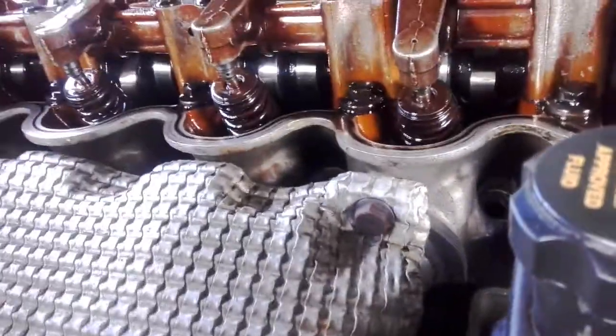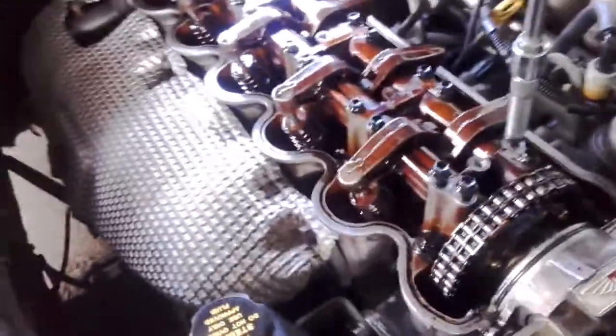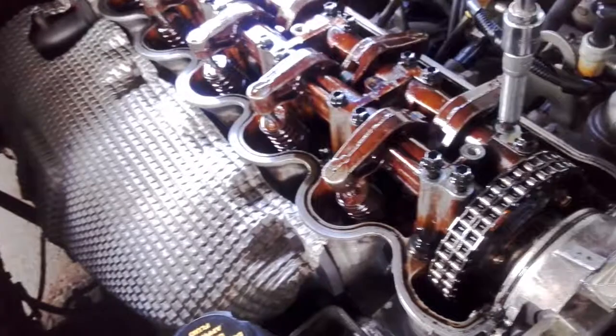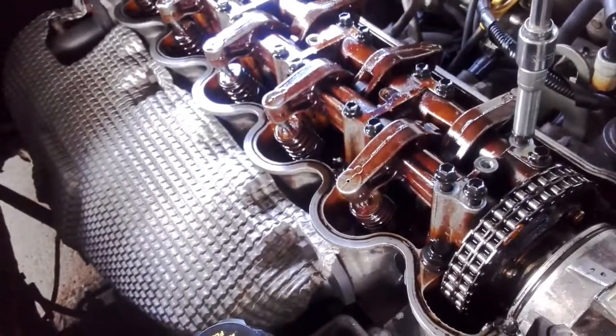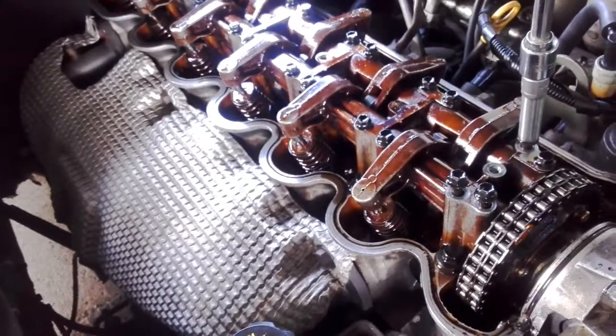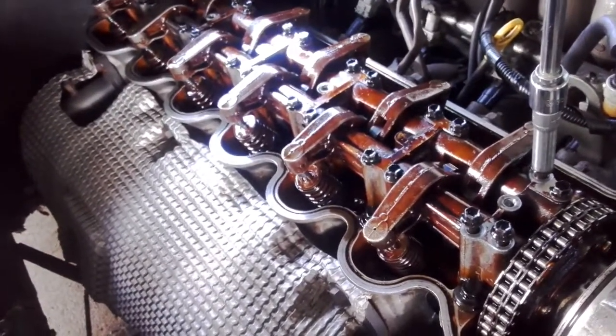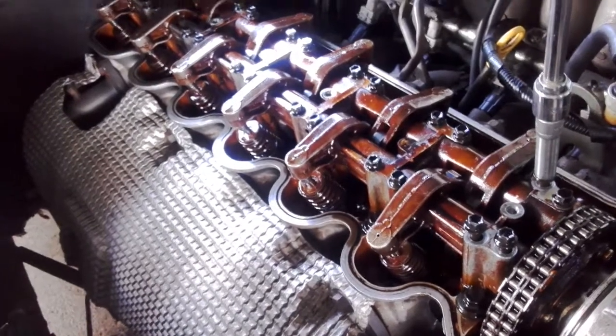Let's go back to the engine. Today what I'll be doing is just taking out that rocker assembly, taking out the washer I've got in between the shims, and I'll just run it at the lash that it ends up with, which is around about 25 thou. That's quite big — 25 thou isn't uncommon for race cams.